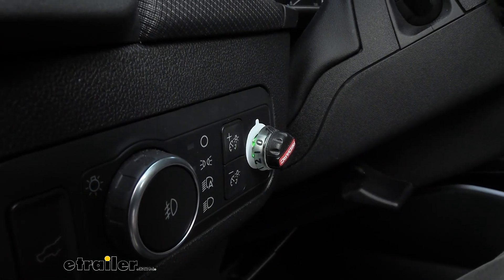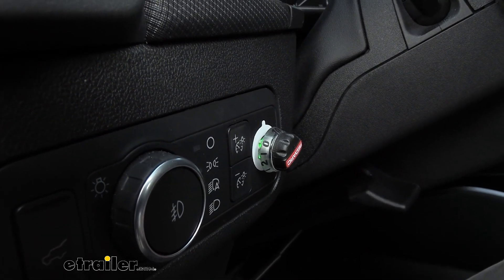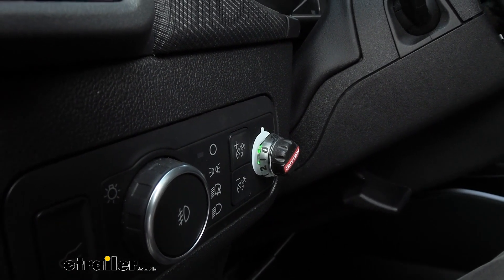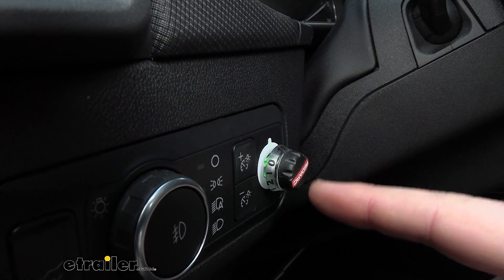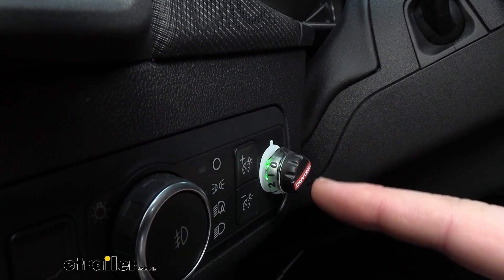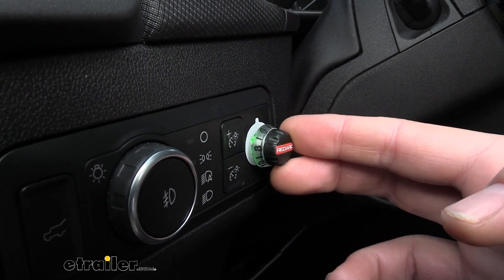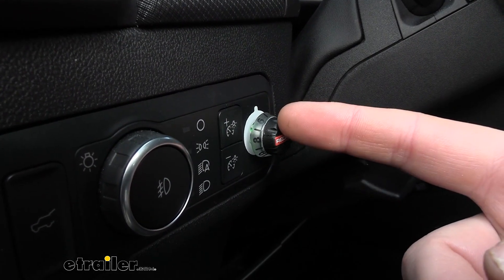When towing a trailer, there are times when someone cuts you off or you need to make a quick stop and don't want to push your brakes too hard. Most traditional brake controllers have a trigger-style manual override; with the RedArc TowPro Elite, you just push a button whenever you need it and then back off. You can also dial the controls from zero to ten — start with five and go up or down from there. The TowPro Elite is compatible with trailers with one, two, or three axles, though with the Bronco Sport you're unlikely to need three axles.